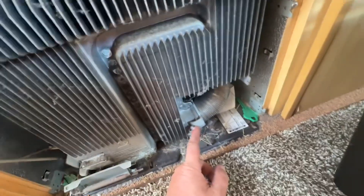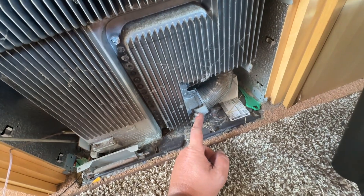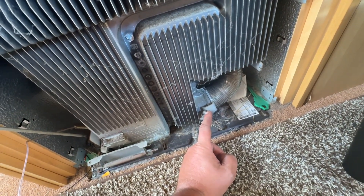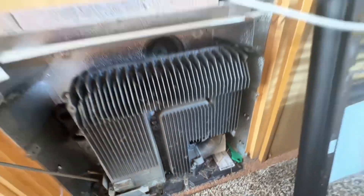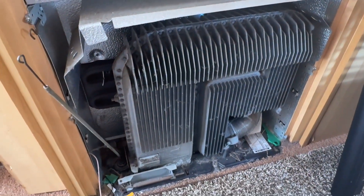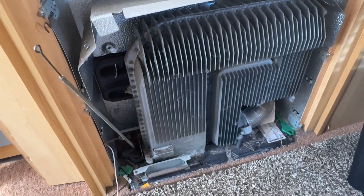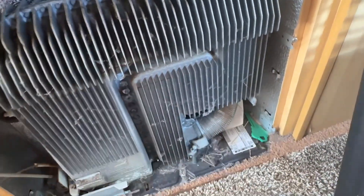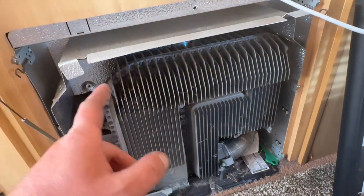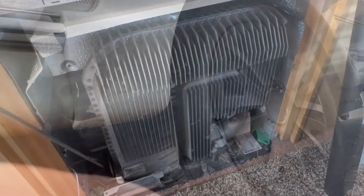When you're undoing this — which is the exhaust duct — you need to replace the red seal inside. This is really important, otherwise you'll introduce carbon monoxide. Also ensure that you have a working carbon monoxide sensor in your caravan; this is extremely important, don't take any risks on this. This seal has actually failed before, which is a good job I'm taking it out — to fix that and to replace that seal.